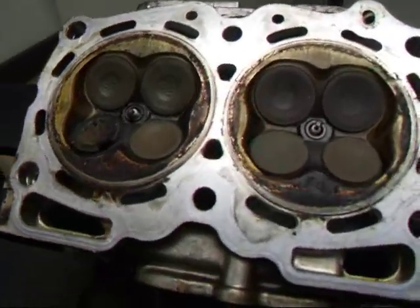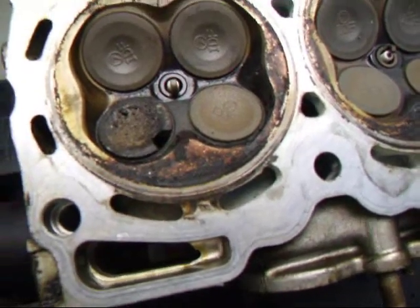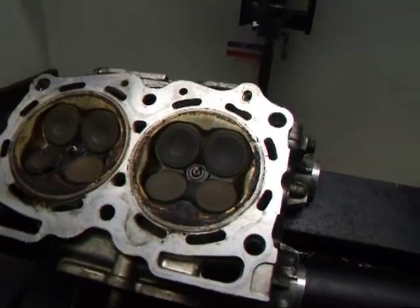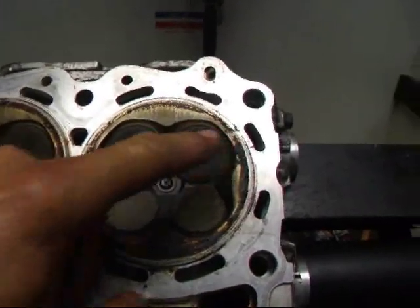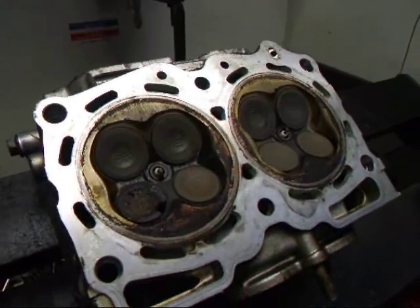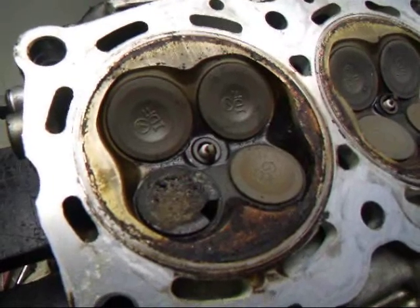Here's the business side of the cylinder head. As you can see, we have one valve that is badly burned — caused by insufficient valve lash, which caused the valve to stay open and eventually burn quite badly. We're going to show you a modification we do here at Costa Mesa R&D: cloverleafing the head a bit more to open up material around the valves. On the flow bench we get anywhere from about two or three CFM all the way up to about 16 CFM additional flow at full valve lift with just that one modification — a real sweet, bang-for-the-buck mod.